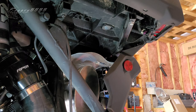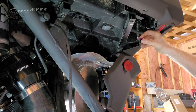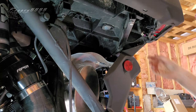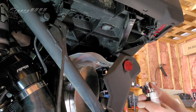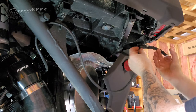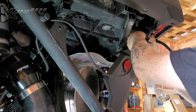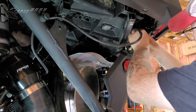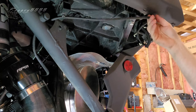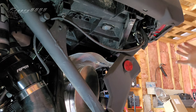Being about preventative maintenance, I'm going to put a little bit of dielectric grease right inside this plug - and the same thing on the other end - because if something can go wrong, it probably will. Then we're literally just going to plug and play: unplug the taillight connector, plug that into this pre-made harness, clip it down nice and tight, put it back into the taillight harness hole, and zip tie up the excess wire. They even include zip ties for this.